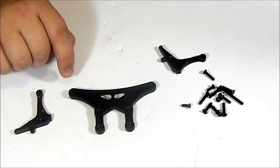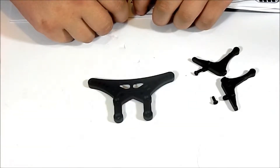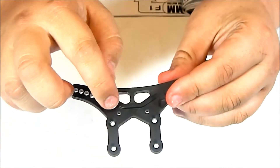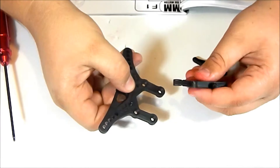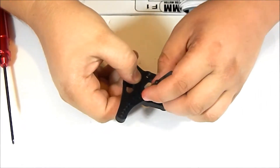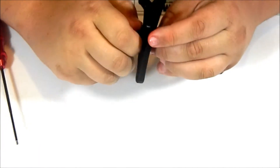Find the two screws needed to mount the body mounts to the shock tower — screw number 705003, which are the two smaller screws from the bag. These two screws are going to mount into holes one and two right up top on your shock tower. Drop one in first — it should come out the other side. Flip it over, keep your finger on the screw, grab your body mount, and make sure this side is facing towards it. There's a little flat piece with a hole in it — that's where it screws into. Use your 2mm hex driver; I like to screw it in by hand a little bit first.